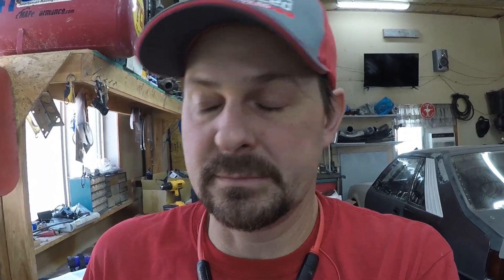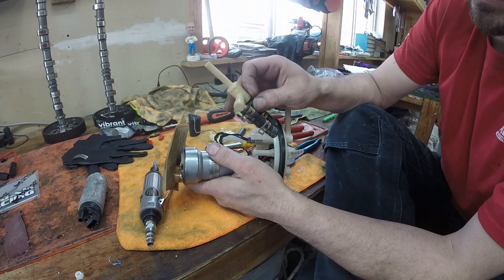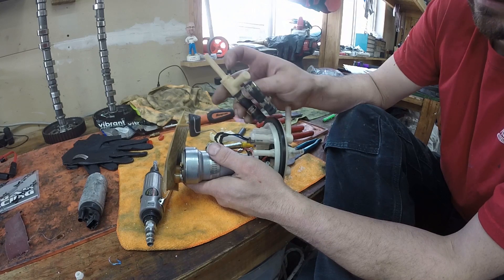We're going to get the double pumper made up and prepped and ready to go. I'll show you the 5/16 crush fitting — not flare, but crush — so it's going to be a 6AN male to 5/16 brass crush fitting. I'll show you that underneath the car attached to the evap line.